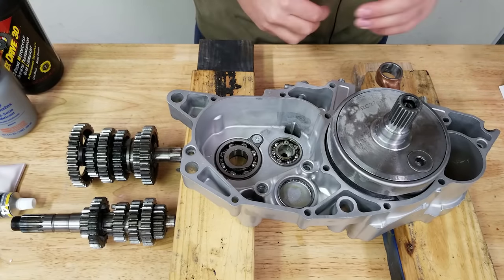Now we're going to put in our Boss Racing billet counterbalancer holder. Apparently with the 250r when you start going into big bore applications, it's pretty common that the factory holder will crack and tank your engine. These billet ones are a little bit stronger and also have some adjustment for a timing plate, though we're probably not going to utilize that feature. We'll put a little bit of dielectric grease on the O-ring, press it into place, and then use the rubber mallet to tap it in.